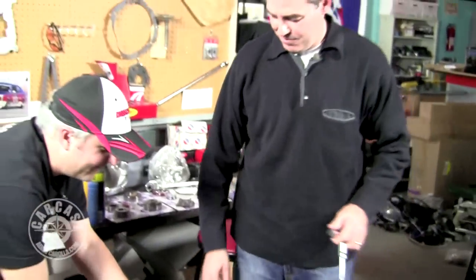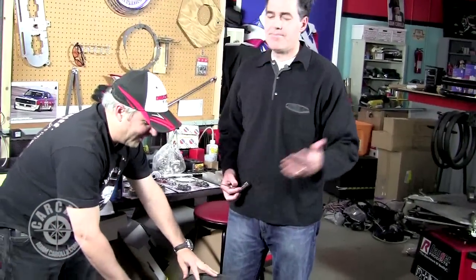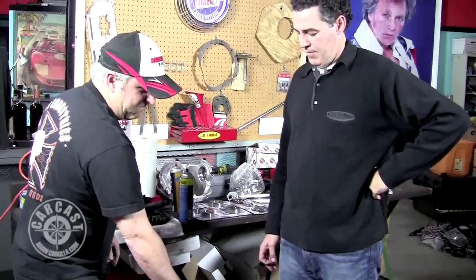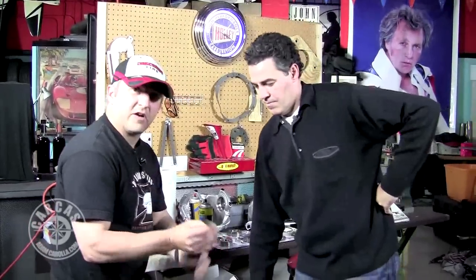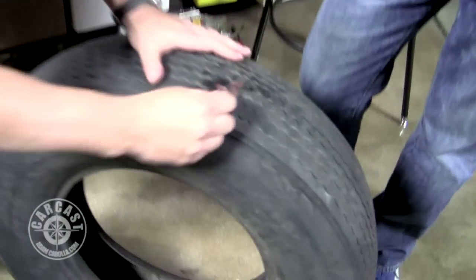So what we have now, besides the goo that's in here, and we'll just... Save that for my hair. Don't worry, I got a jar full of it. We're almost done. And the last thing you want is that piece of jerky hanging out of your tire as you're rolling around. So you pull out the machete. And this is a dangerous cutting blade that comes in all the kits. And you just cut it flush to the tire.